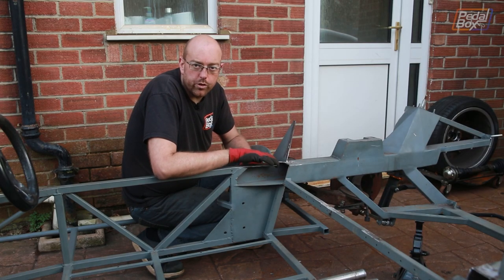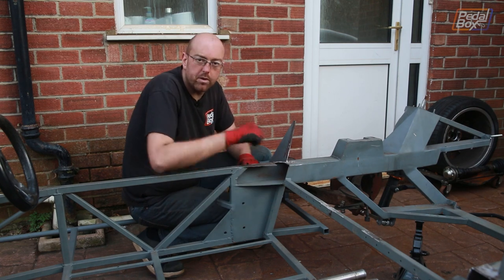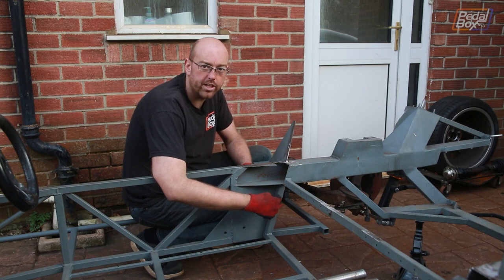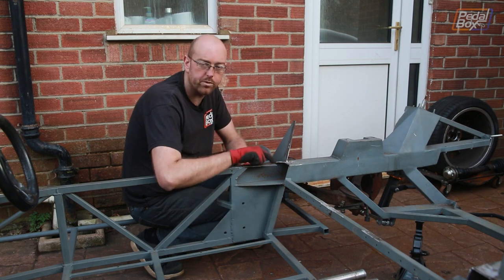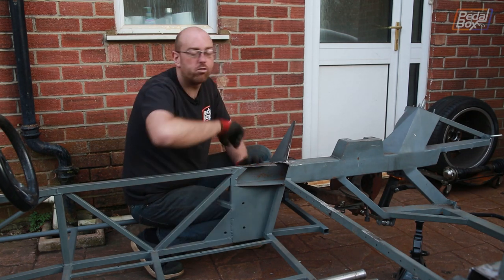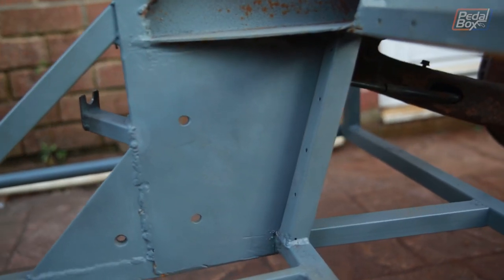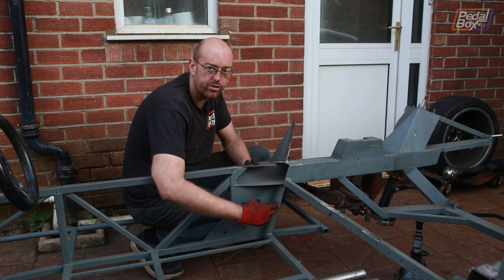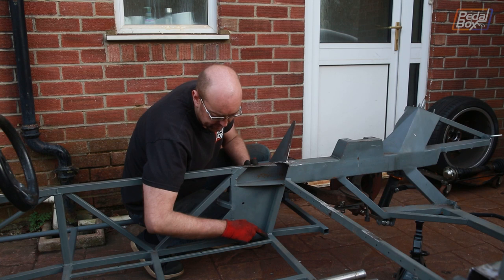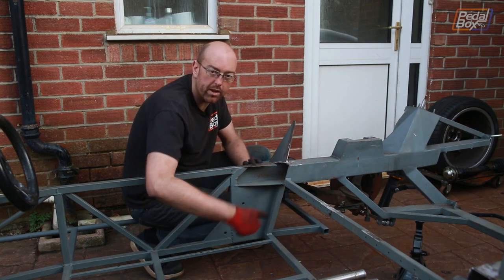Our notches are cut in these rails for the hoop — it fits nicely in and comes down to the inside edge at the bottom of our chassis rails. I'm also going to take out this inch box section that sits underneath it and replace that with a piece of inch and three-quarter, the same as we're using at the top. That'll give a good deal of strength all the way from the bottom of the car right through the roll hoop. I'm just going to trim the plate back as far as I need to and align the lower section of tube the same way, extending it out a little to create a base, then seam weld around the top and again on the bottom when we flip the chassis.